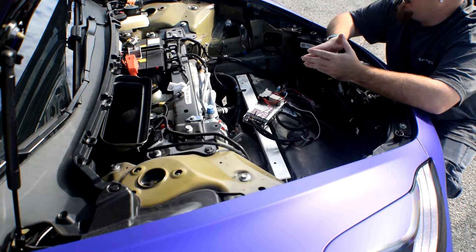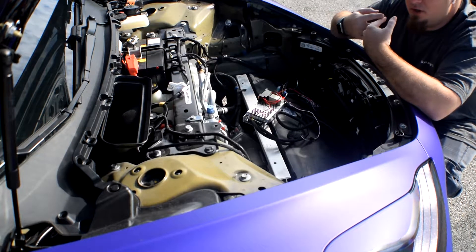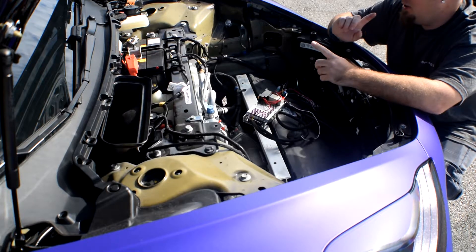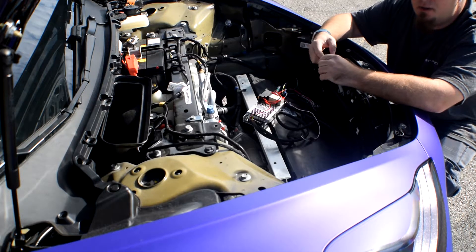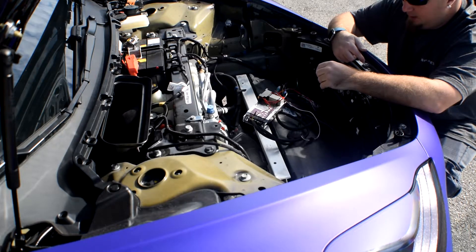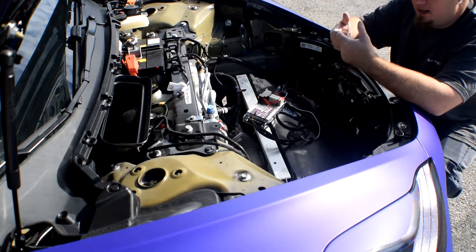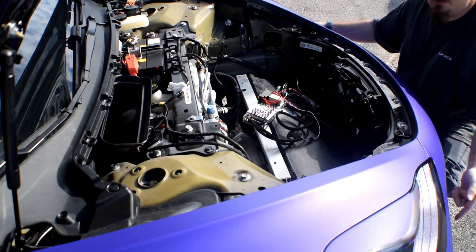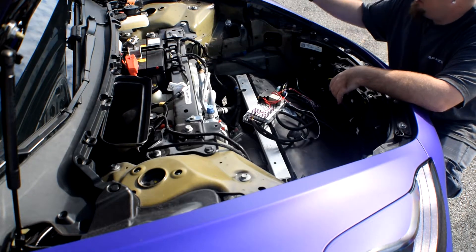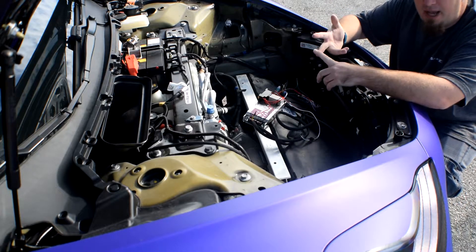They're mirrored from the left side to the right side of the vehicle. We come in, split off, and do 150 LEDs down each side, giving us the 300 LEDs. From the back, we also ran a wire from the front all the way to the back to not only supply power to the back side of the LED strips, but also grab the data out to send it back up to the front. That data then comes up front, we split again for the front bumper and front vent. We split and go across to the fog lights and then down to the air vents — that's the end of the line. Each LED strip has its own home run for input and output to grab power and pass the data lines across to the next LED.